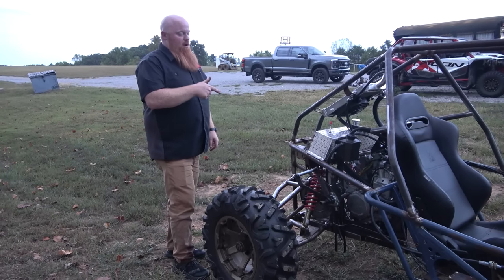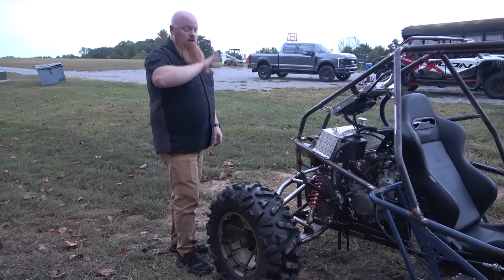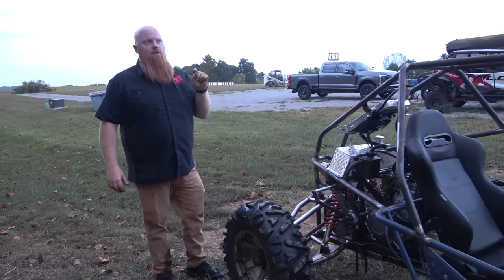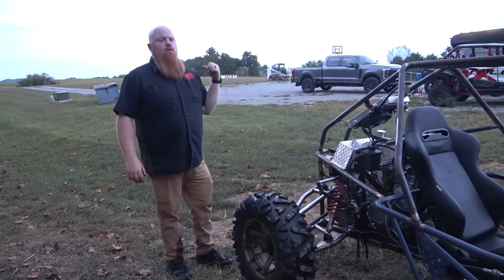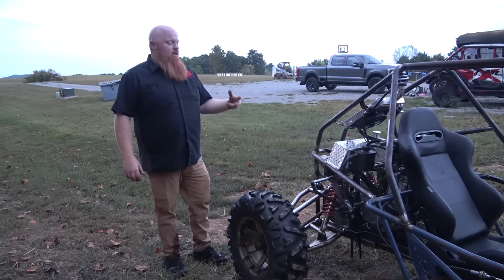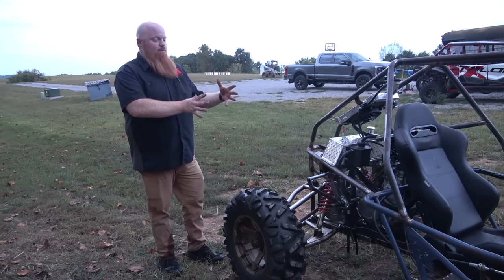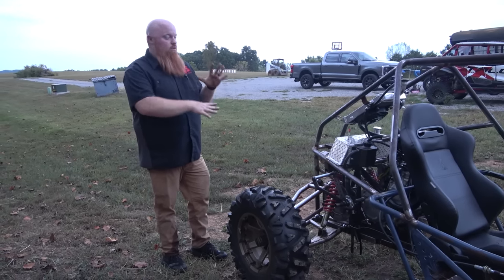But I'm gonna get a smaller front tooth for the engine to gear it down, because every one tooth you go down on the front is like going down three on the back, I think the saying is. So I'll probably go with the smallest one they make, and then I'll have to build a chain tensioner because that engine can't move from right there. I've made it now, so that's where it goes.